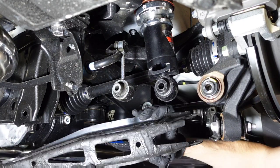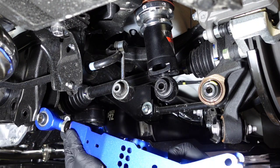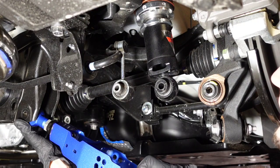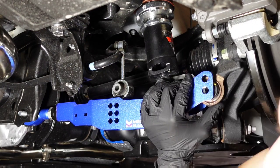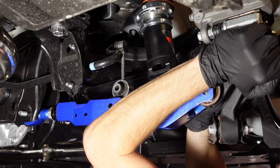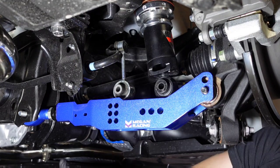You can see all that gooey mess on the bottom of it — I don't know why they do that, it's only on the control arms. Now we're going to grab our new Megan Racing lower control arm, slide that through the back of the frame, and get a bolt through that. This is adjustable — you can see these adjustments right here. This is going to correct most of our camber without even adjusting it. We're going to slide a bolt through the steering knuckle, then grab a floor jack with a block of wood, lift up on the control arm, and that's going to bring us up to our sway bar end link and coilover so we can put the bolts through those as well.